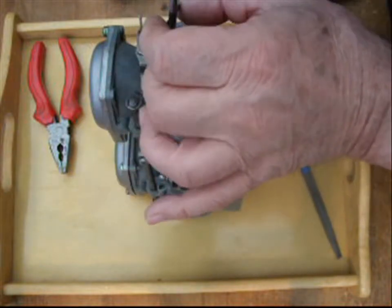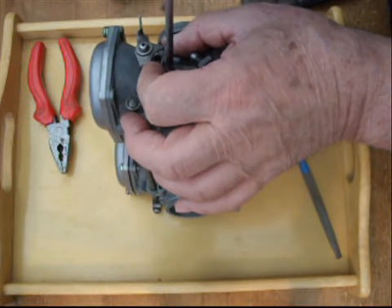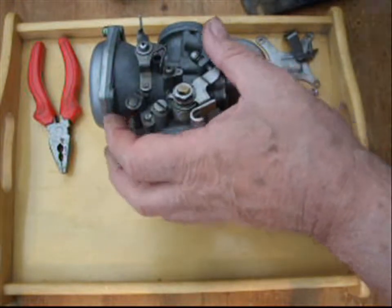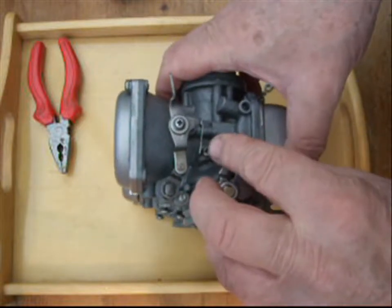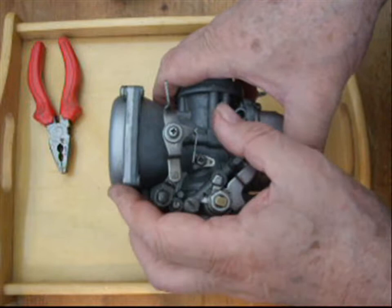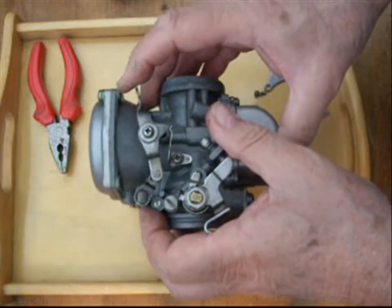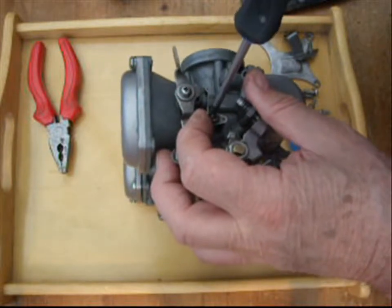I'll just put this bit back in. I'm not really convinced by this part at all. Until I get my original carburetors off the bike and compare, that just doesn't look the right length to me. And because there are so many parts been changed on this, it wouldn't surprise me if that was off of another model. I think that should hold the choke on more fully, but it's actually only holding it a slight bit. See, that's not even properly aligned.